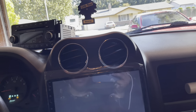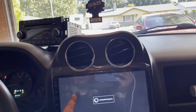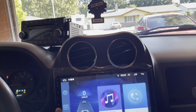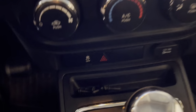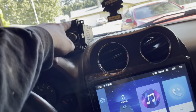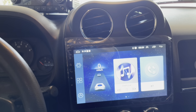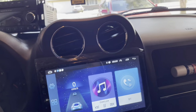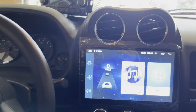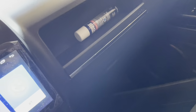What I love about Android radios is that it's so versatile — you can do whatever you want, like download any apps. The stereo just comes off and you will have four extra screws when you're done because you won't need those, it just clips back on. I'm going to install the backup camera but won't bore you with that. That is the install for this Jeep Patriot radio.